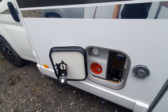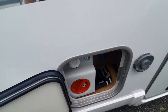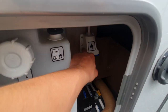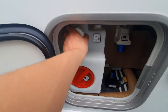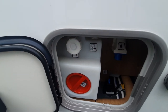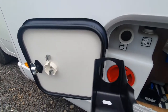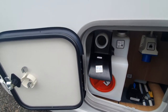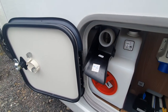In your convenience locker, it contains your fresh water tank and your boiler drain down point, along with your hook-up cable. When using the fresh water, simply unscrew this, remove the plastic container, slide that on, then you can put your hose pipe in. The reason it does that is any water that comes out will just flick out and not go onto the inside of the van.